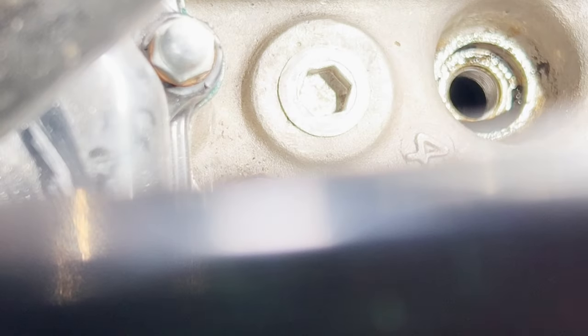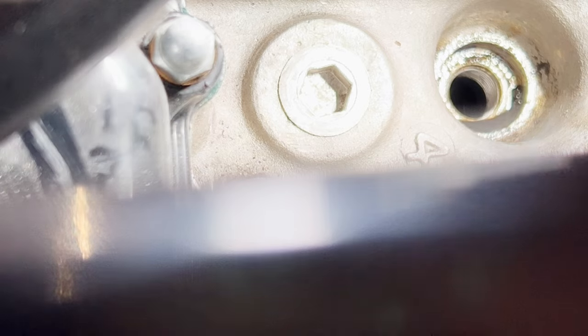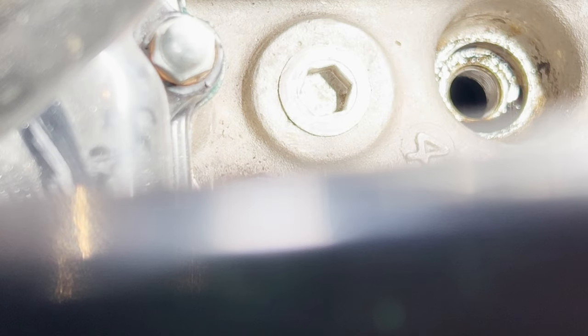Right, you can see number 4 there. Put the tube in. Quite the best tube, but it will do. No resistance on that. So the valves are open on number 4, but they're shut on number 3, which means that's what we're firing on, number 3. So that's where we'll set the strip up.